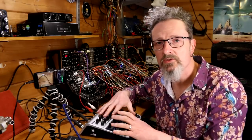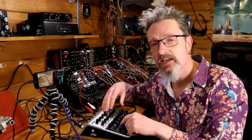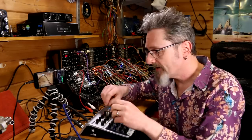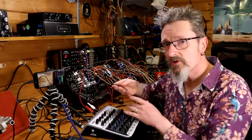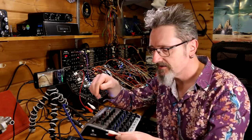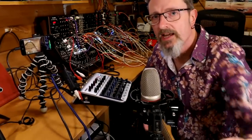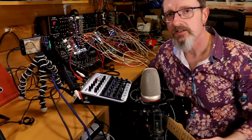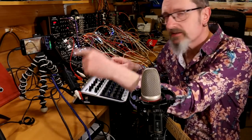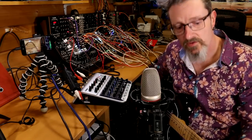You can use a little mixer to set up the sound. So you can have a proper microphone going in here, like your condenser microphone, and your guitar going into here. Mix that correctly, take the output of your mixer and plug that into the iRig. So now: guitar, got a guitar, got a proper microphone going into my mixer, the output of the mixer going into the iRig Stream, going into the phone, going out over the internet.